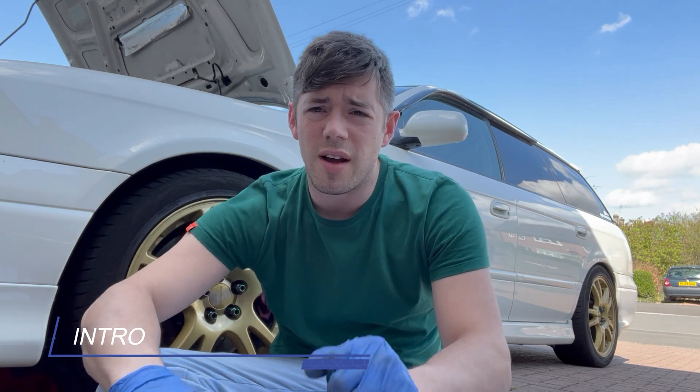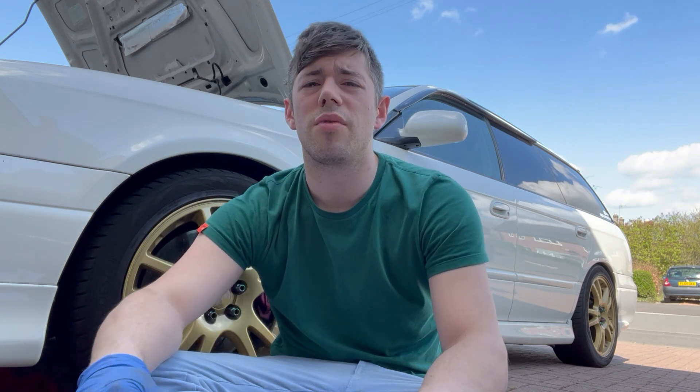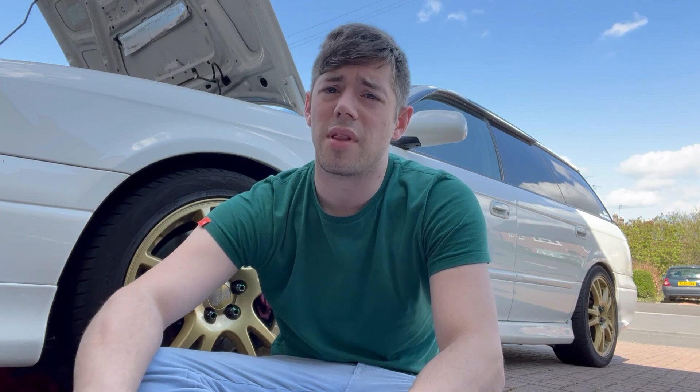It's a nice day, so I thought I'd come out and have a look to see if I can find what the problem with this thing is. Having spoken to a couple of people, it's possible that it's actually a valve shim I've lost from all the anti-lag and the launch control that I was told not to use. So if I've thrown a shim, it does sound like it could be that — I'm going to get the valve cover off and have a look.